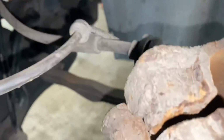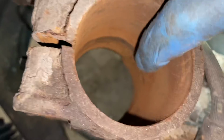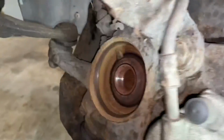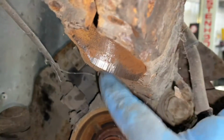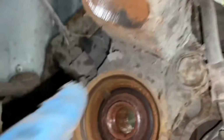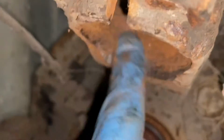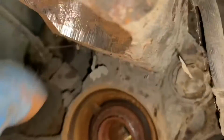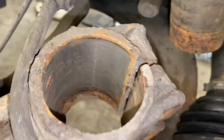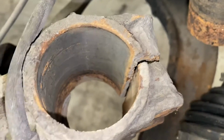And onto the hub, what I have done, I'll try and show you as best I can. So usually, inside the hub there's a little lip that sits around the bottom just to stop the shock from actually dropping right through. You can see where I've actually ground it off around the bottom here. So this again will gain me another about 10 to 12 mil, I'm led to believe. So I'm going to get some emery cloth, just clean all this inside of the hub out, and then put this side all back together, and then make a start on the opposite side. Just keep watching.